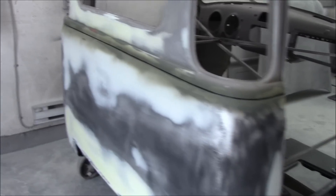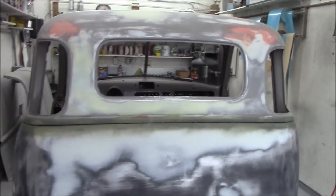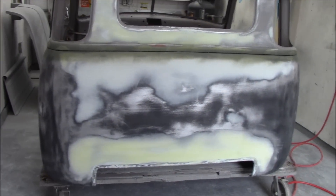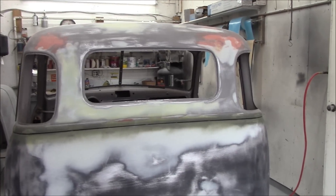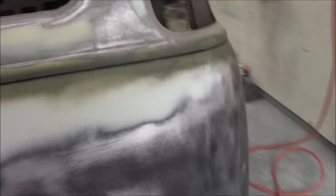You remember our little pickup cab we were doing? Well here it is. I managed to finish off welding on the whole back half — the back half is done, finished. Now you're probably thinking, what's that body filler there? Well, like I said, when you've got something perfectly straight you usually skim coat it, so Dave went through and skim coated it. It's very thin — you can see it's just a skim coat to get any fine little wrinkles out.